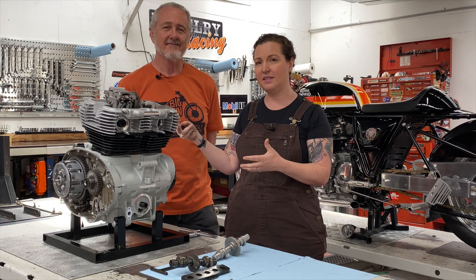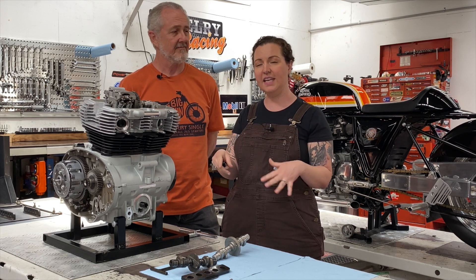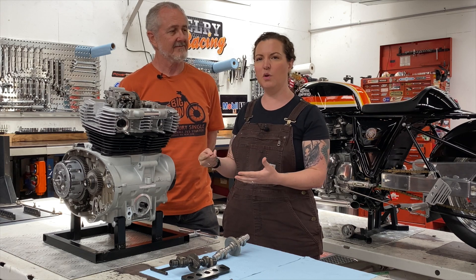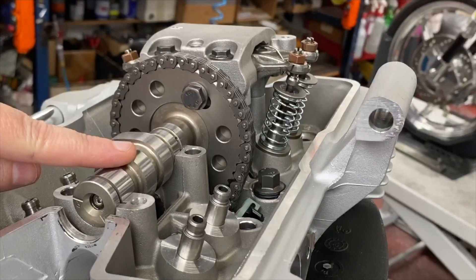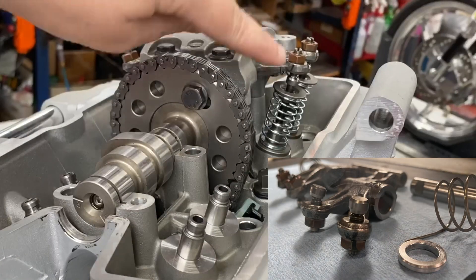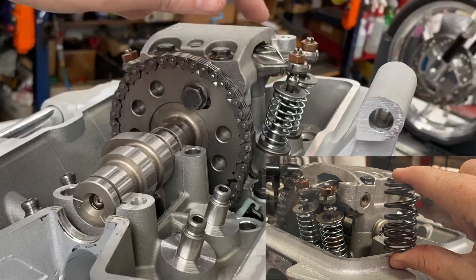Today we have cams, as mentioned, and there are going to be a lot of technical terms. You'll need at least a fundamental understanding of how a four-stroke engine works — we'll add a link in the description to a video that explains that. So today we are getting into your engine's valve train. The valve train is made up of the camshaft, sprocket, chain, chain tensioner, the rocker arms, the valve — which is inside the spring — and the spring. These are just lightweight springs we use for checking clearances, not the heavy-duty ones actually installed in an engine.